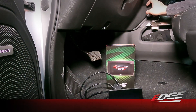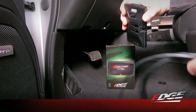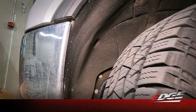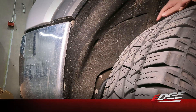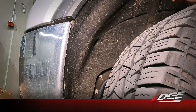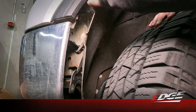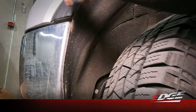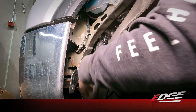Remember to shut the truck off and turn off the power. We're going to move out to the fender well and remove the inner fender liner to get access to the ECM for the unlock steps. Here we are at the fender liner — we've got the tire turned so we can get better access. There are six torx screws holding this fender liner: two at the very bottom, a couple along the edge, one tucked up inside, and one push-pull plastic pin at the very top in the middle. Once all of those are removed, we can push this liner back behind the bumper and fender trim to get our first look at the ECM.